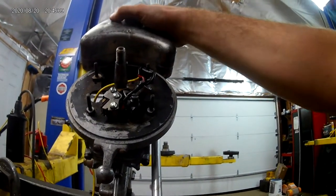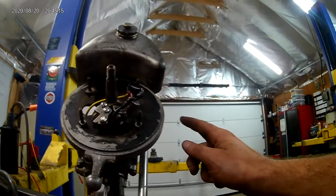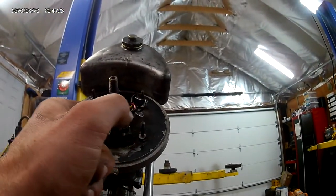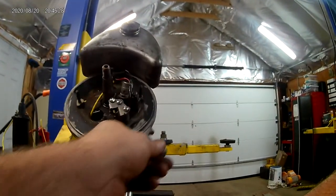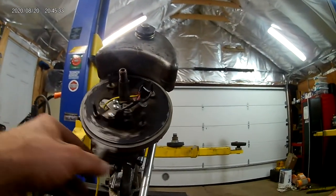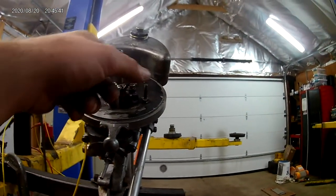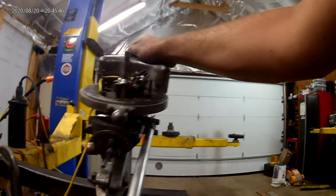The points follower contacts the crankshaft all the way to the right, which you definitely can't see with my hands in the way. Here's basically how I did it: I got the motor to top dead center with the piston all the way at the top of the stroke, made a mark on the gas tank and on the flywheel so I knew where TDC was, then made sure the points would open just before that. With the timing play I have in the mag plate, I can compensate for whatever I missed. I have an OMC condenser where the original points went, tack welded to a little piece of metal rod — and it actually works.